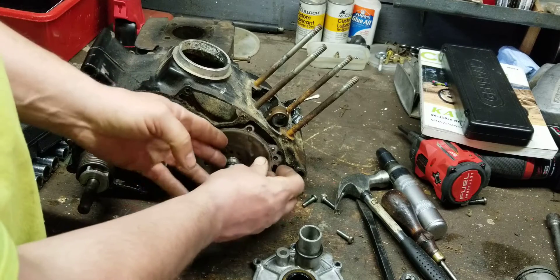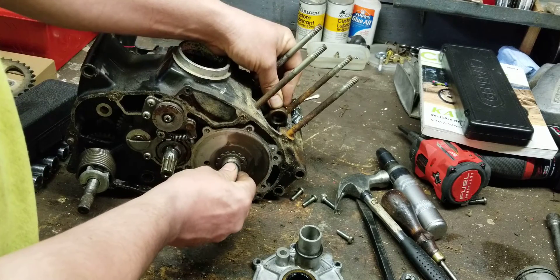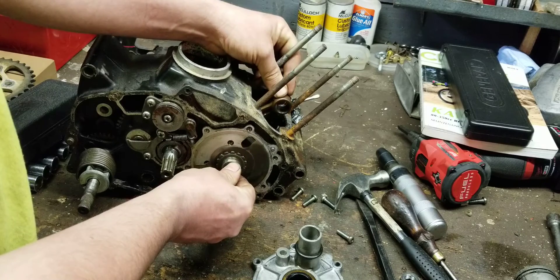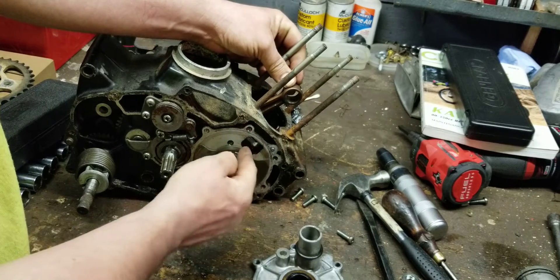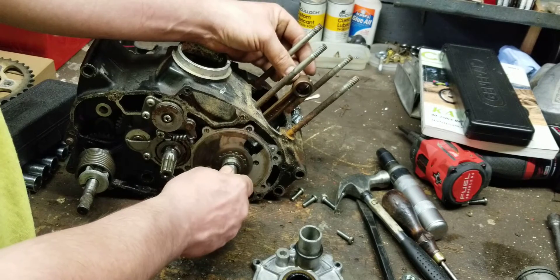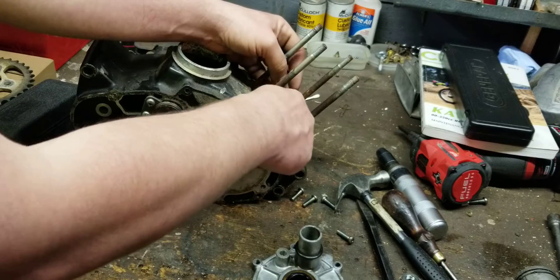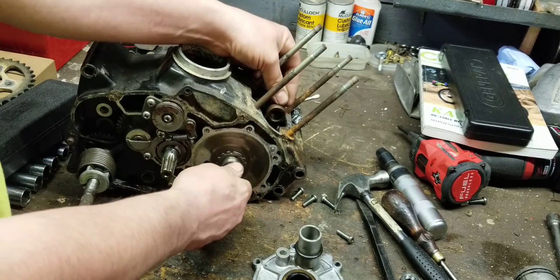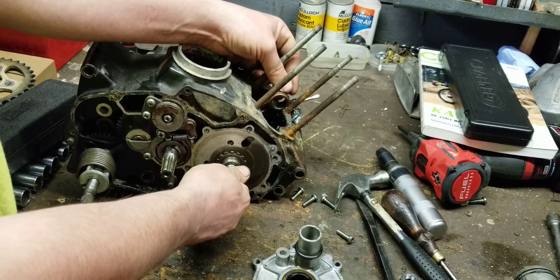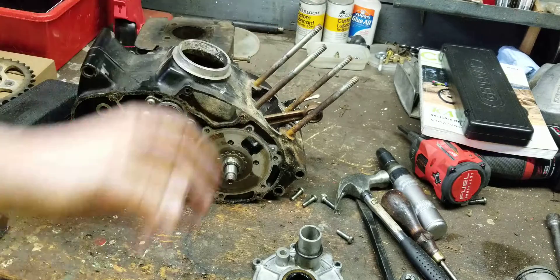Let's flip it over and see the correct orientation. Piston at the bottom starts to come up — now the piston is sucking up and the fuel and air can get in. All the way at the top it fires, now driving it down, compressing, pushing the fuel and air through the transfer ports. Then going back up, sucking more fuel mixture in and igniting the charge on top of it. That is the correct installation.